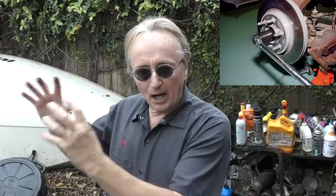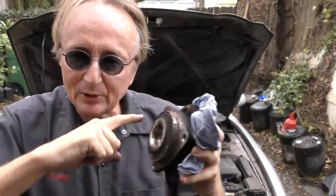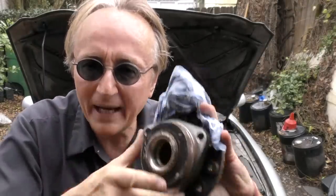On modern cars, when they're worn out and you're getting a hub assembly, it comes with new seals, all new parts — it's pre-greased and the grease is all inside and done correctly. All you have to do is bolt the old one off, bolt the new one on, and do it with the right torque setting. Your entire car is spinning around on these things — one on each wheel — and even though they have no actual maintenance on modern cars, now you know how to make them last as long as possible.